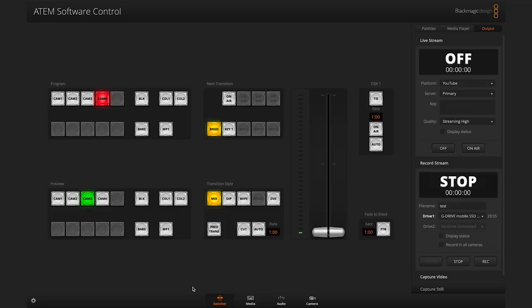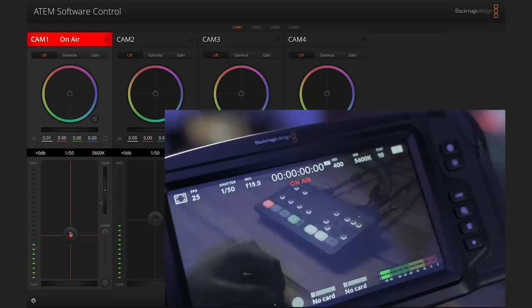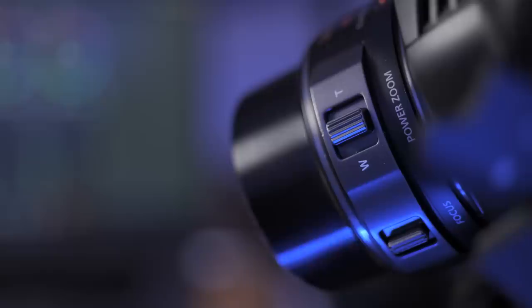The second great feature is full integration in the camera control panel for remote camera control. It allows me to control all the camera settings — ISO, shutter speed, gain, white balance — and I can also adjust iris and focus when using stills-mount lenses since they're electronic and active. What's really cool is if you put a servo lens on there, I can even control the zoom remotely from the software control panel. If you already own these cameras for filmmaking and you're looking to step into live streaming, you can operate all that gear from this one device and a computer.